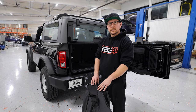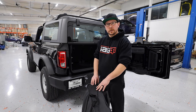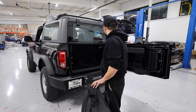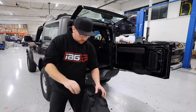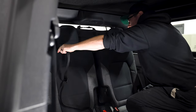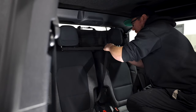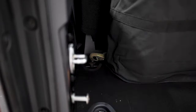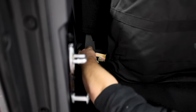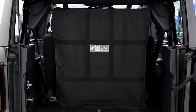Then we'll lift our back glass and lift our tops into the rear of the vehicle. Secure the top buckle latch first around the outside of both headrests. Then secure the two remaining bottom latches. Now your front panels are safely secured.